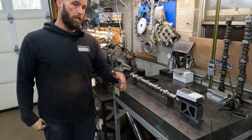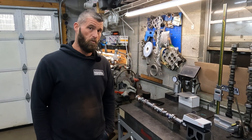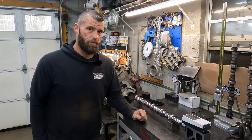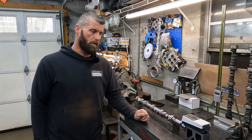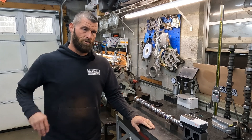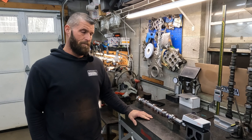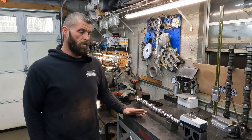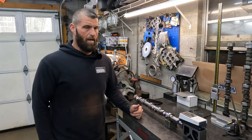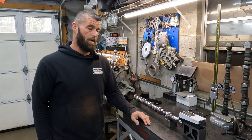All the cams we do are going to be between eight and 12 pretty much, and that holds for all materials. Anything under 20 is fine. Some people say the slicker the better — I don't know if I agree with that a hundred percent, because even some OE stuff had problems with cams that had too fine a finish. The wheel would slide sometimes and create problems with the lifters. Going below where we're at, I think it's diminishing returns for the labor involved to get it lower than an eight — I don't think it'll pay any dividends.